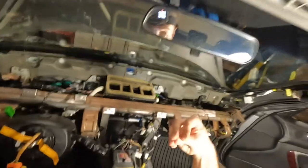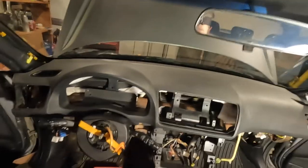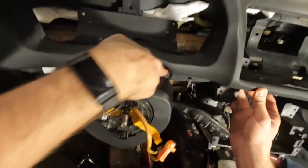We're going to put the dash back in now. Reassembly isn't too bad — same process. One thing I forgot to mention when removing: there's one little pigtail over in the corner for the security sensor — you want to pop that out of the dash before you pull it. My new dash doesn't have that little light so I can't use that pigtail. Also, this 2005 dash is a little different — it didn't have the tilt wheel, so I have that part of the housing to deal with. I'm going to cut that out so it doesn't bind.